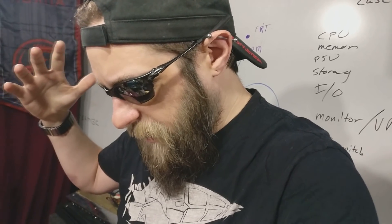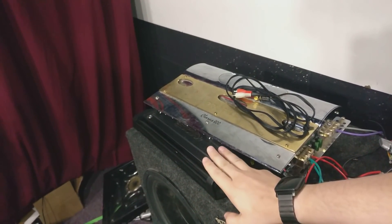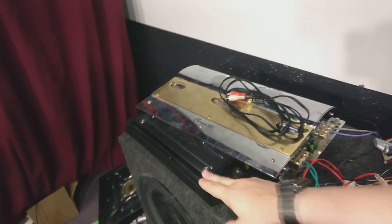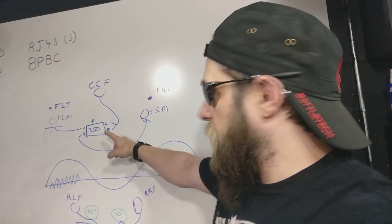It's a big project I'm working on, directly related to the fact that my car's amplifier exploded on me a couple of years ago and I've never really replaced it. I've got a couple of amps — this is an 800-watt four-channel amp, that's a 350-watt two-channel amp. If I bridge the 350, I get a stereo signal into a mono channel — left and right into a single. If I bridge the 800, I only get left, which is kind of annoying.